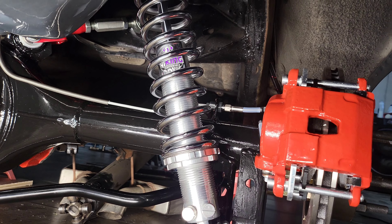I just bent up a piece of metal since I don't have the lines yet — I gotta order them — just to see where it's going to sit, as if it's the actual line, so I don't have to wait to weld the tabs on. I'm going to weld these tabs on the housing right now. I also need to take this off — it mounts the center piece for the splitter. I don't want it to be too short. They sell different lengths; worst case I can get another one. I'm either going to make a shorter bolt or weld a nut on the housing, or weld the bracket to the housing entirely.